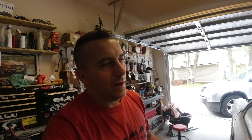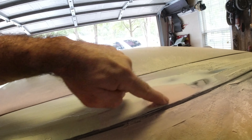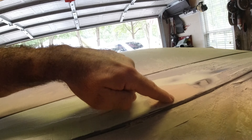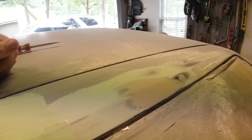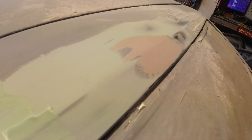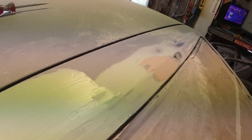You do have to be careful on your body lines on the side of the car — don't press too hard. But once you start getting close, you can just kind of lay that thing up there and ever so slightly work that body line down. What I like to do is sand on the bottom first, block that out, then sand on top, block that out, and then come across the top. Just in case any of you are wondering, that's not finished — that's not feathered out yet. I'm just showing you guys how I go about it.